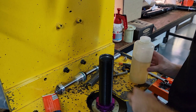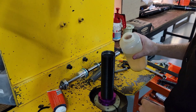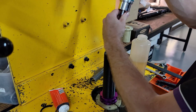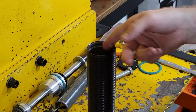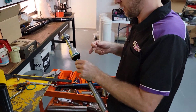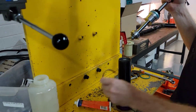What we want to do here is get the floating piston down just enough so we can put some oil in, then put the piston, shaft, and seal assembly in. So we're going to fill it up with oil — not quite to the top. Now take the seal assembly, put a little bit of grease on it. This is obviously a second-hand one just for demo but I still inspect and grease it. All right, so now we're just going to turn the machine on.